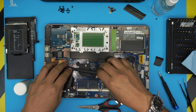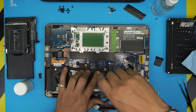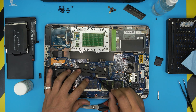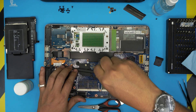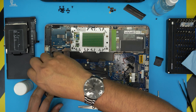Place the heatsink right in there and bring it down. Once you screw it down, do not lift it up again — otherwise you'll have to repaste. Always cross-screw: do one, two, three, four in a cross pattern — the order doesn't matter as long as you cross-screw them. Make sure you also tighten up the screws for the fan.